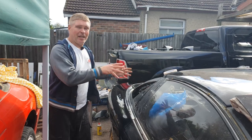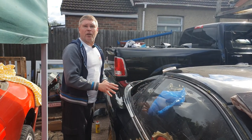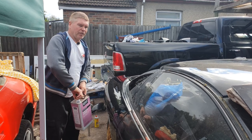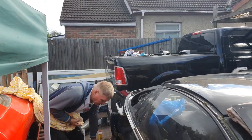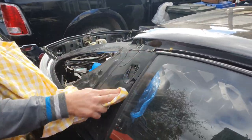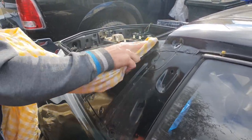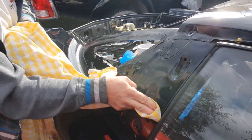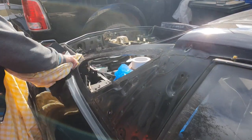So hopefully that's enough said about paint — I've gone totally off subject. Let's get back to where we should be. Here's where we're going to be working now. The three panels go into this area. First thing we've got to do is make sure everything is ready to bond down properly. To do that we're going to start with some degreaser. There are natural greases and oils in the air all around us and they're going to stop the adhesion working properly. So we get a clean rag, some degreaser, and just clean the whole area to make sure it's all clean with no grease. Everything is going to be under panels so if it's not absolutely perfect don't worry — it's purely to make sure we get a good bond when sticking it all down.